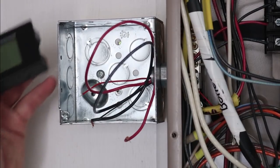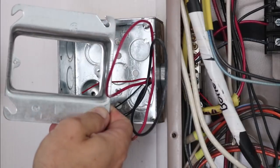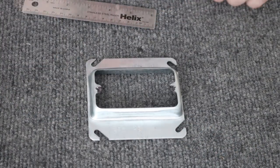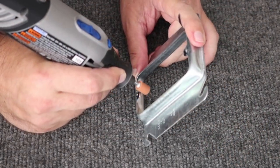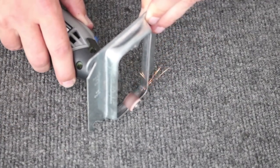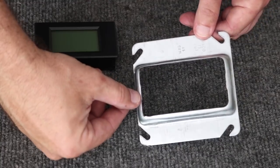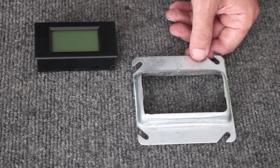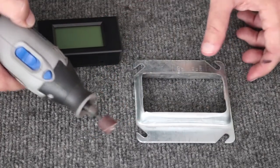With the wires through, before installing the panel meter I need to figure out how to mount it on the trim ring — and that means it's time for the Dremel. That took a little more grinding than I thought. I took the tabs off almost completely; they're not quite as wide as the width of the meter but pretty close. The rough sanding drum on the Dremel seemed to work best for trimming down the metal fast.